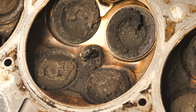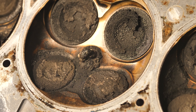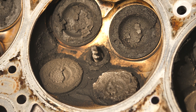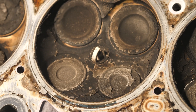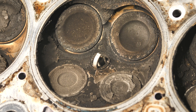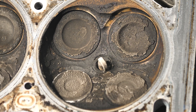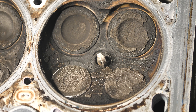There's massive oil burning happening on cylinder three. Cylinder four shows lots of burning involved, but at least the spark plug is clean. Cylinder five looks just like cylinders one and two — pretty normal, little carbon buildup, nothing too bad, spark plug working good. Cylinder six also has a good spark plug and normal valve buildup as usual.